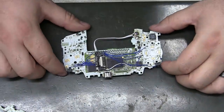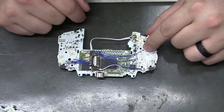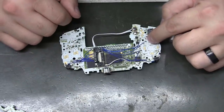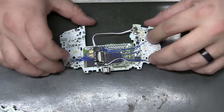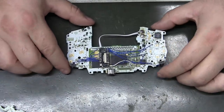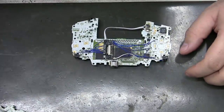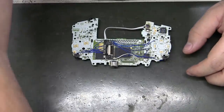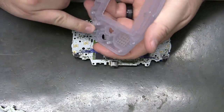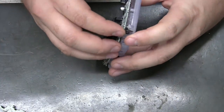The Kynar is honestly only slightly easier to work with. Like, you can't tin the very tips of the wire as well as you can the stranded. So you don't have this big glob of solder to easily basically weld it to the test point solder blob. But not that big of a deal, and the biggest benefit is, like, see that wire right there goes right through that hole that I said was kind of in the way when that chunk of plastic comes through it. I guarantee you now it won't even hardly register.